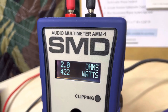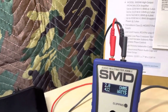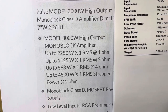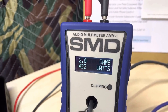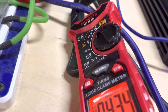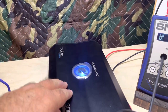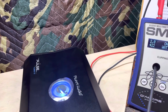422 watts at two ohms — that's pretty severely overrated. They rated it up to 1125 and it did 422 up to clipping. The voltage dropped to 14.6 and the current draw was 43.4 amps. I'm a little tougher on this amp.